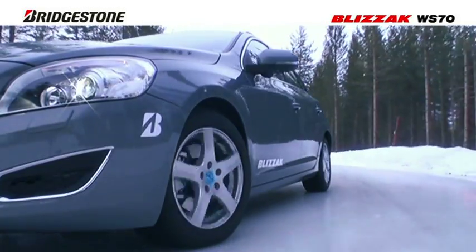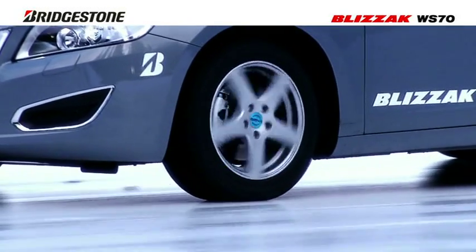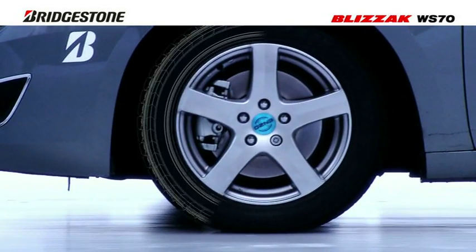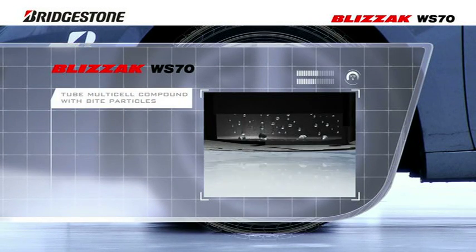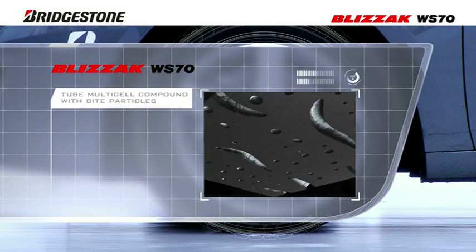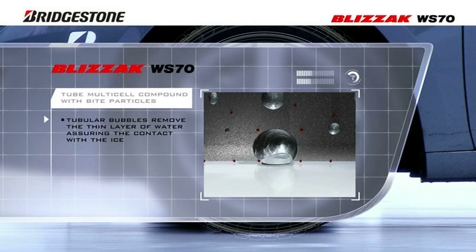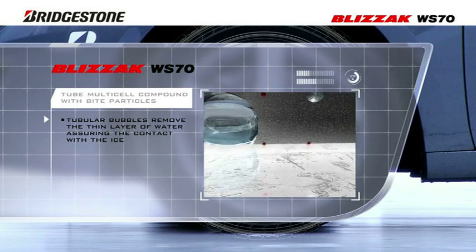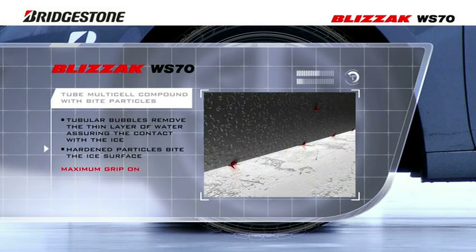The Blizzak WS70 incorporates Bridgestone's latest tube multicell technology with bite particles to maximize traction on ice and frozen surfaces. Tube multicell is a unique rubber compound with tiny tubular-shaped bubbles. These tubes act like a sponge to help remove the thin layer of water from the surface of ice. Once this water is cleared, the hardened bite particles grip the ice for even more reliable braking and acceleration.